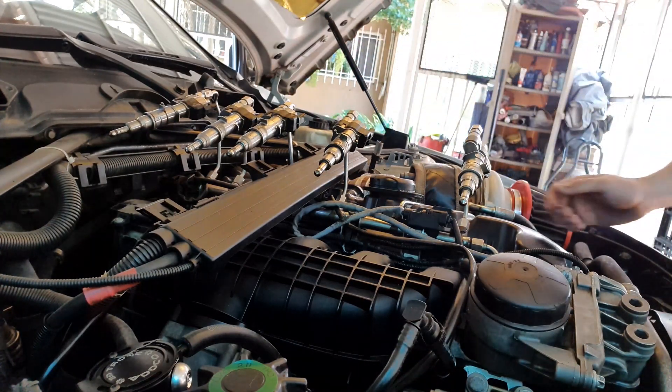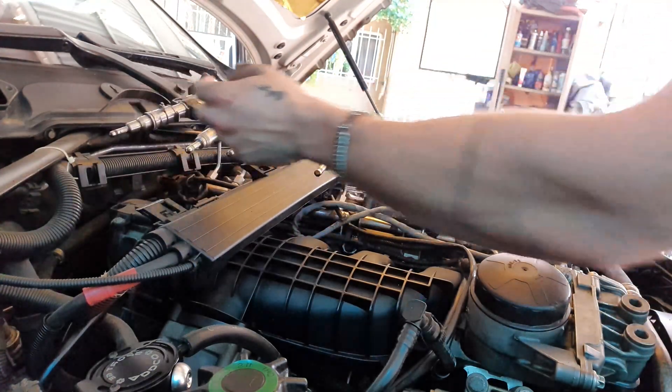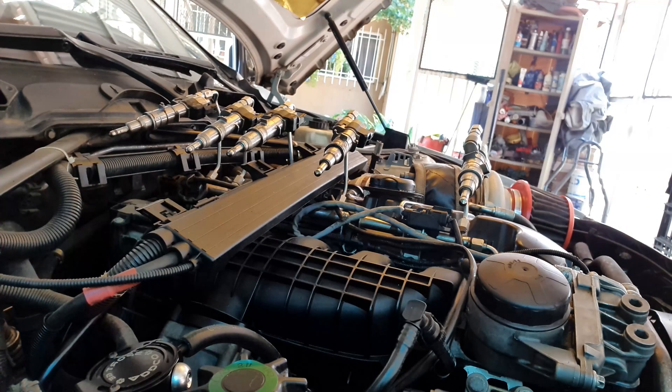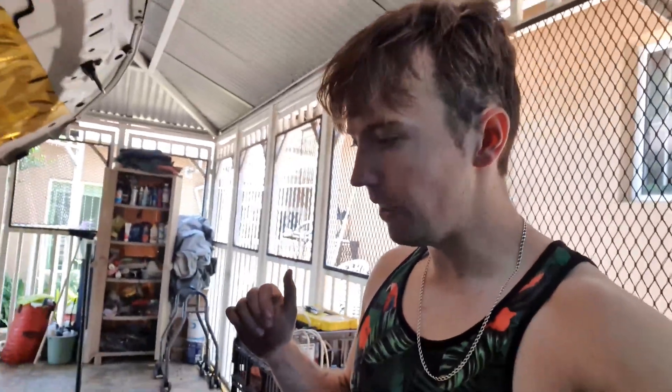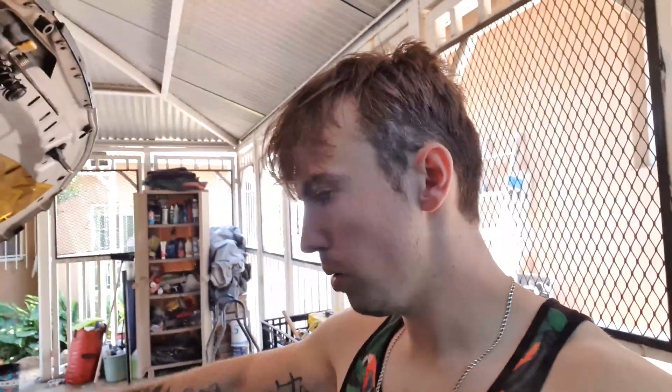We should have quite a bit of pressure in the system now and all of them are dead dry, which means I don't have leaking injectors. I'm not sure if that's a good or bad thing, because it's a waste of the problem-solving then. So I think maybe they're just clogged up because they all did look really bad and dirty. I'm going to do the O2 part in the next video where we can disconnect the O2 and test that. And if that doesn't work I think I've probably got clogged injectors. Let me know if you've got any clue how to test if they're clogged.